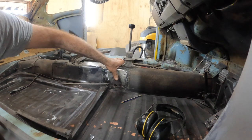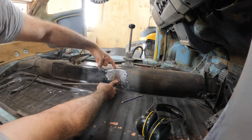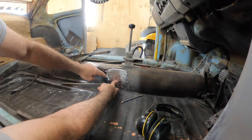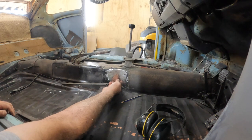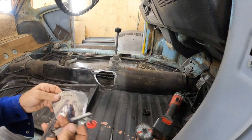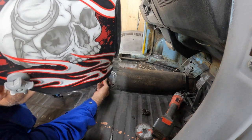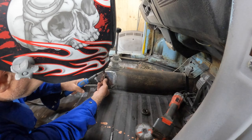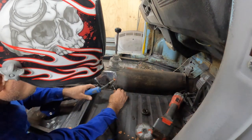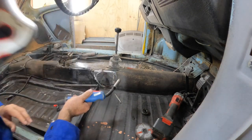That looks like that's where we've got to chop our piece out. I think it's just going to be easier to run the grinder around this lip, and that's going to give us exactly the spot where to go. I'll grab a yellow texta or something to mark the outside perimeter and then chop it out. Here's our piece - I'm just going to use this magnet to hold it and make sure we're level all the way around, which we are. Now we can fully weld this sucker.